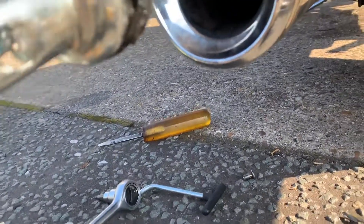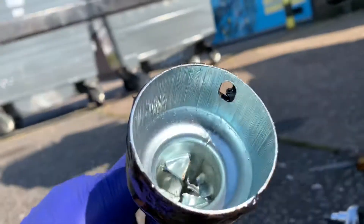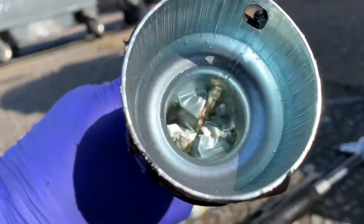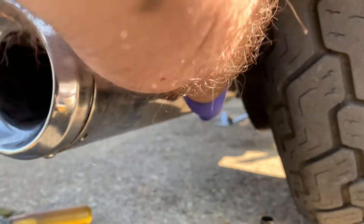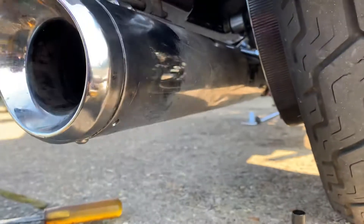What we're going to do is put some of these baffles in — decent baffles. You can see the prongs in the middle, and you can still see through them, so you're going to get a decent sound. Halfway down this muffler it's going to divert into the baffle pack, and then it can all come back out through the perforated tube in here.